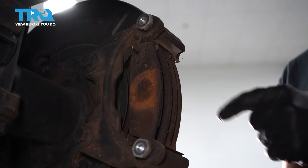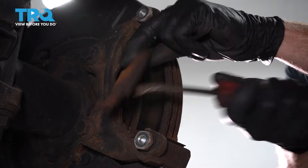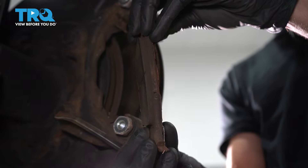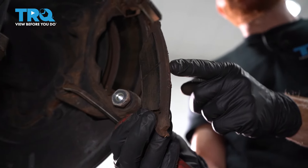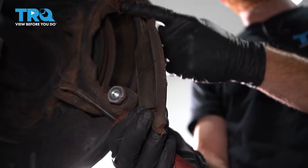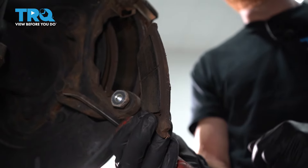Next, let's remove each of our brake pads from the brake caliper. It's common to have to use a prying device — go ahead and slide it in there. Once you have your pads out, you want to give them a close inspection. I just want to make sure it doesn't look like they're worn at an angle. If worn at an angle, there could be an issue with a caliper slider or the pads were stuck in the bracket. Either way, you want to make sure you correct it before putting in the brand new parts.